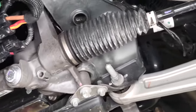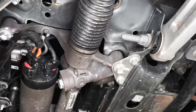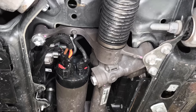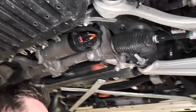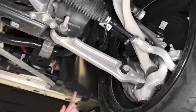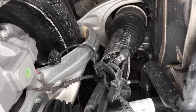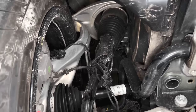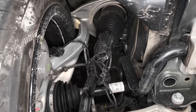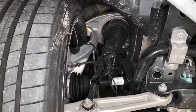I'm noticing a theme of serviceability. On the front suspension links, we have a double wishbone virtual ball setup — up top there's an aluminum wishbone, and then on the bottom, although it's not a wishbone, you have your tension link and lateral link. This really helps driving dynamics, particularly for tracking and high-speed maneuverability.